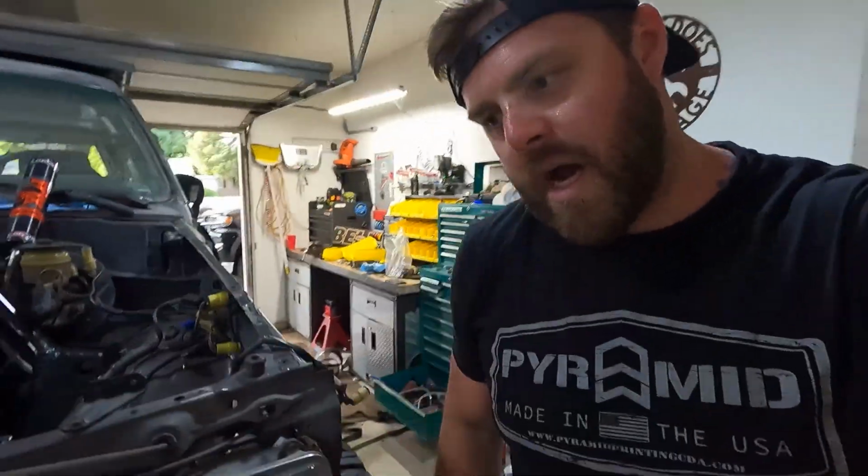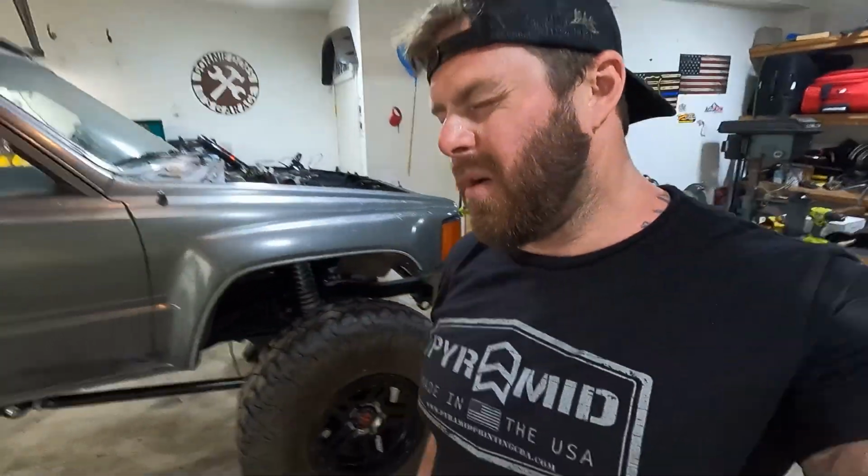So anyway, I appreciate you guys staying tuned and watching this shock outboard. I know it's not technically an outboard because it is a third gen rear, but you can find these third gen rear axles for like $100 on Marketplace all the time. So even if you have your own third members, you can just stuff in your third member into that third gen housing, bolt these shocks up, and put some tabs on the outside of the frame, and you're good to go.